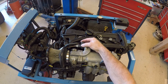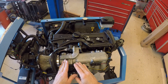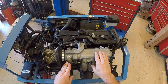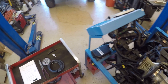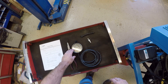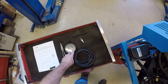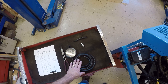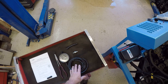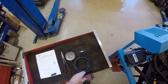Right here is my idle air control motor, which allows air to bypass the throttle plate. That's why I have to do this on a warm engine. I've previously warmed up this engine, so it's all set to go. I have a vacuum gauge here, which reads from zero up to 30 inches of mercury, though we'll never get there — we're going to be up around 20 to 25 inches. This is an adapter and a piece of hose I can use between a vacuum source I find on the engine.